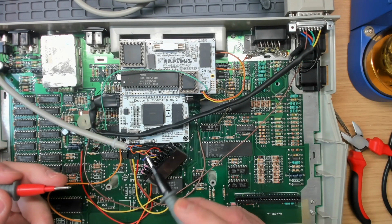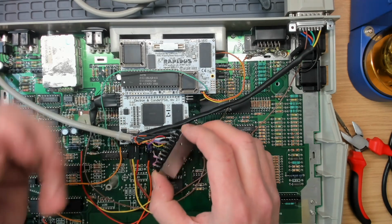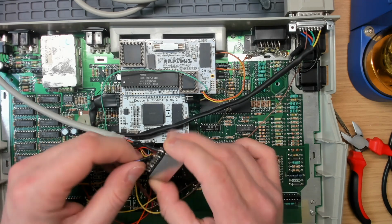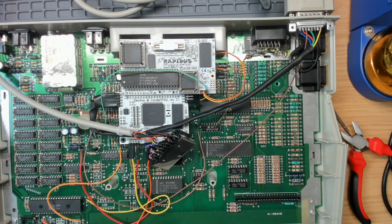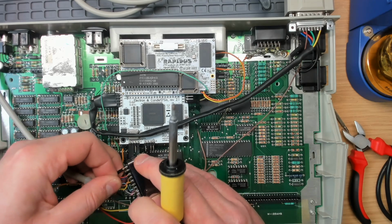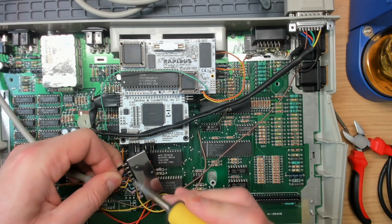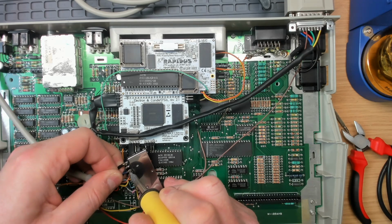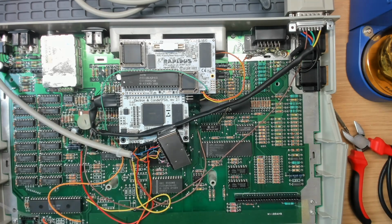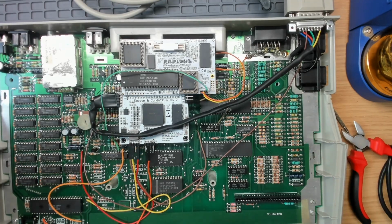So it was connected. It is that one. It was the resistors that were stopping me from getting a beep. That was a bit of a stupid mistake. So it is going to the right place, but those resistors need to come off. So let's take them off. You see, I didn't use my brain there, because I should have realised that I should have put the meter in resistance mode instead of diode mode. But you don't need resistors on the RGB control signal.